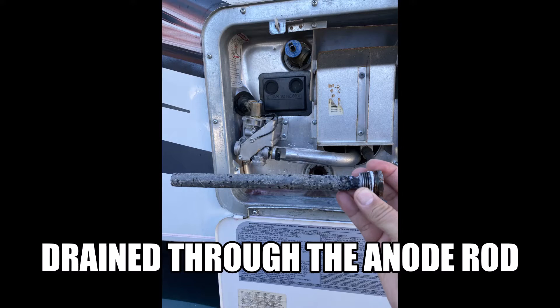I'm hoping to get some more content out. Today what I'm doing is I'm gonna be winterizing my camper. It's a bit late in the season but still above zero overnight — used to go a bit below zero but everything was fine inside. It's a four season camper so nothing froze up. First thing you want to do is make sure you drain all your tanks and make sure they're empty, and before you put the antifreeze in, on my camper there's a hot water tank bypass valve you want to switch so you don't fill your hot water tank full of antifreeze. I did drain my hot water tank already as well through the outside of the camper.